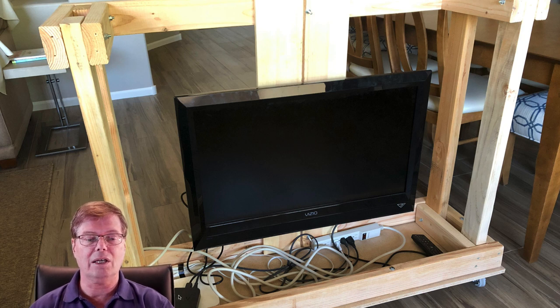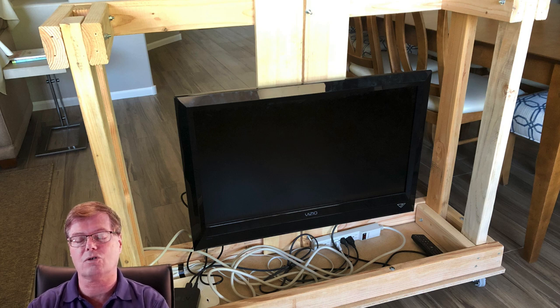For electronics, we used an Apple TV connected to the monitor with an HDMI cable and a power cable. I also added a Wi-Fi router — this is a 2009-vintage Apple Extreme, but you can use anything you have available or get a parent to donate one. Older Apple TV generations two and three still support screen sharing, which is all you need. The idea of a dedicated Wi-Fi hotspot is to avoid lag from sharing signals with others on the network. The downside is it's not connected to the internet, so any video you want to show needs to be stored on your phone or iPad.